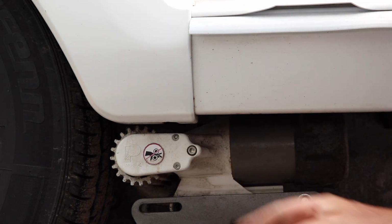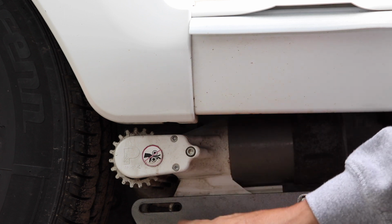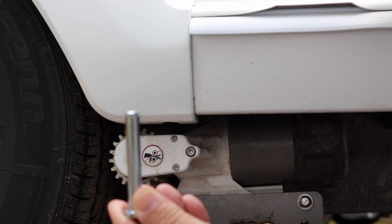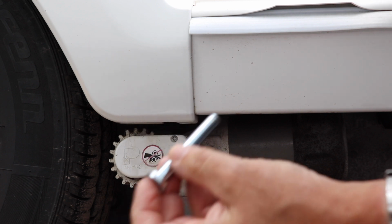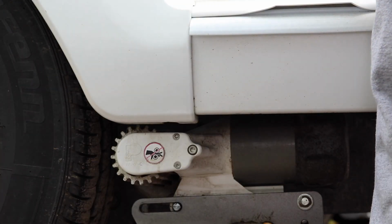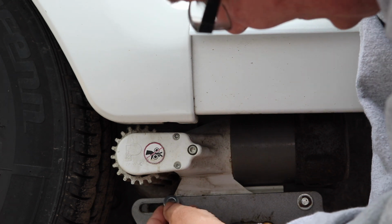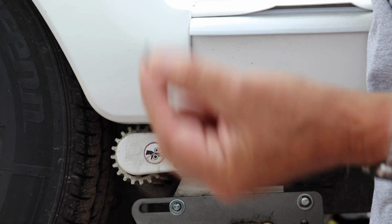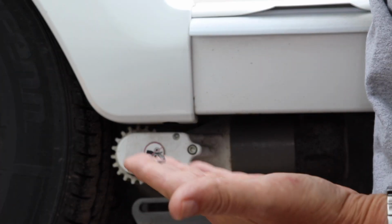Now what you need to do is make sure that this is aligned carefully, because the pin itself has to go in from the rear. So we're just going to do that. As you can see now, we've fitted the pin, and then we need to take a washer, fit that over the top. And then the difficult part is fitting this E-clip that's in my hand there.